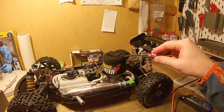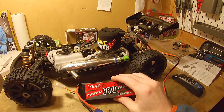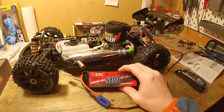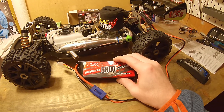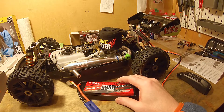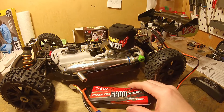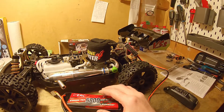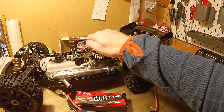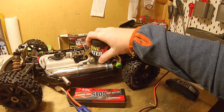I think this is an okay solution if you just want to take something out in the field and you don't have electric power there to plug in a heat gun. You just have to take a 3S LiPo battery with you and preheat the engine for about 10 minutes before you start running. You can maybe also connect it to the car if you have 12 volts. No smoking now — so that's good. It was just the first time startup that we had some smoke.